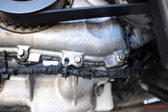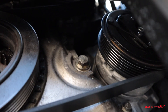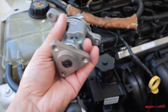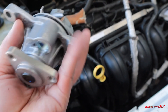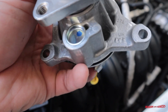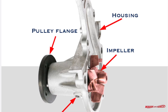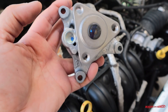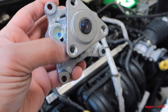The water pump is leaking and it's coming down on the side of the engine. Today we're replacing this OEM FOMOCO part in our Ford Transit Connect. Every water pump I've ever encountered has what's called a weeping hole — it's that little tiny hole right there. When the water pump starts to fail, it has this little weeping hole by design to let you know it's failing. It's a visual indicator that you need to get this looked at and replaced right away.